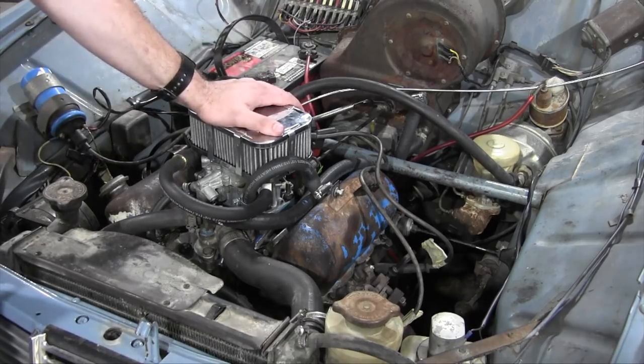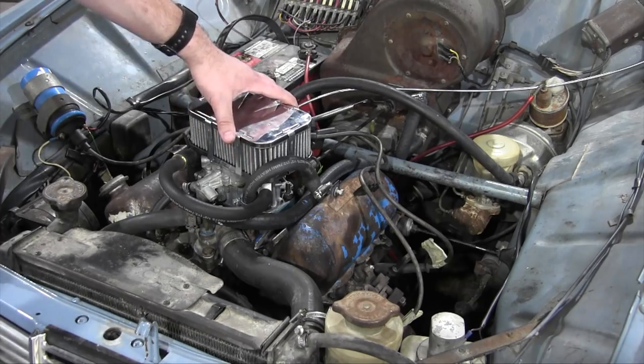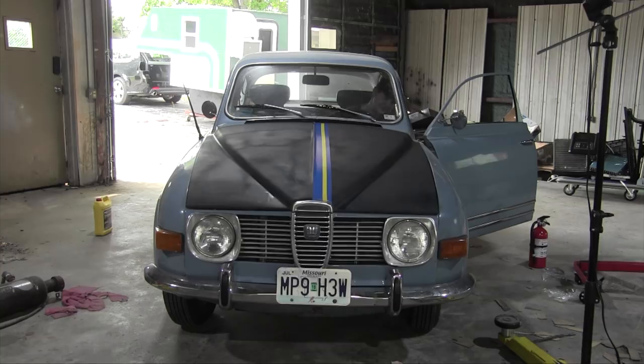All right, the carburetor is cleaned, put back together, and put on the car. Now let's start the engine and see if that cleaning did any good at all, or if I just wasted my time and got some gunk out of there. Well, let's see if the engine runs any better now that the carburetor is clean. Okay. It's cold, that's for sure. I'll save you the confused pondering dialogue. No, the carburetor cleaning appears to have made no difference at all to the engine running. It still doesn't idle and will not run properly without being at least somewhat choked.